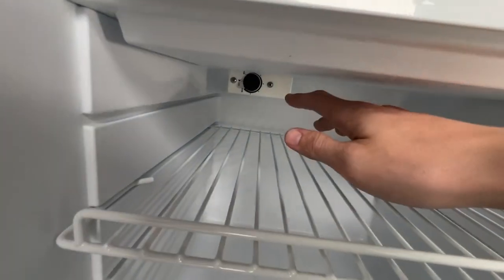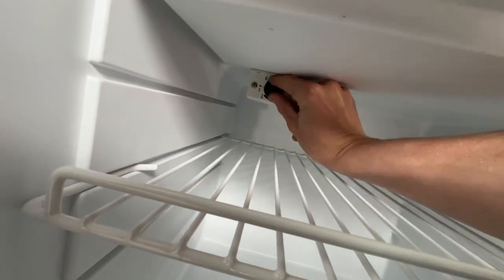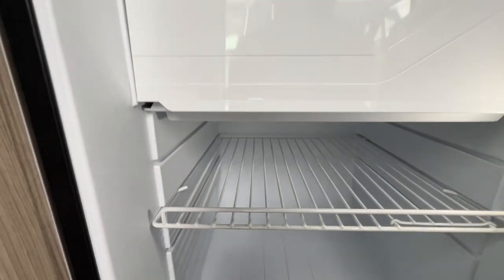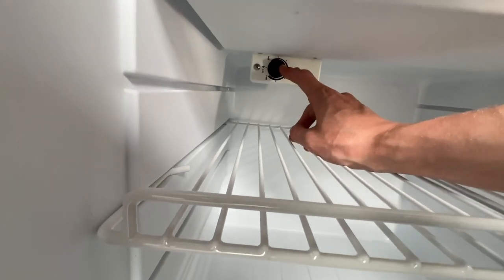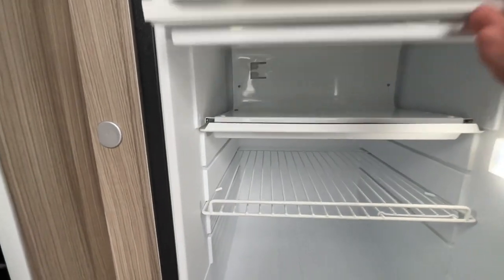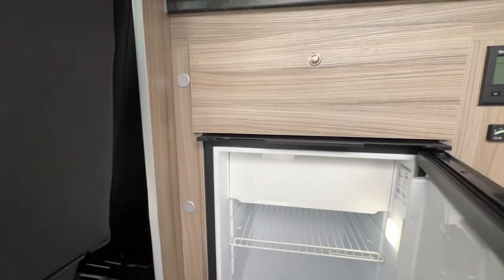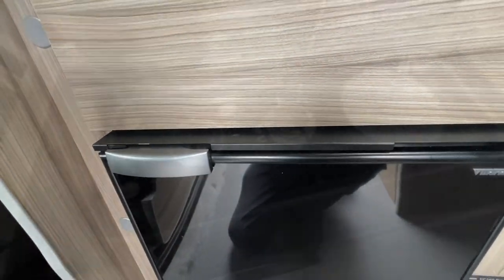In your fridge there's a controller at the back where you can select temperature and turn it to minimum or off. You can also turn it on and off from the main control panel on the electric unit at the front, but regulate temperature from this rear dial. You may want it on max when pre-chilling, then turn it down after a few hours. There's your freezer box which is really cold and works as it should. When not in use, leave the fridge door open to allow air to circulate and avoid smells and mould from trapped air.